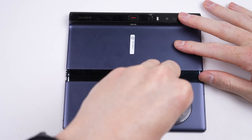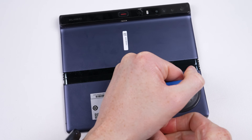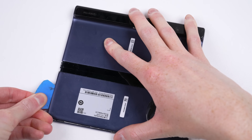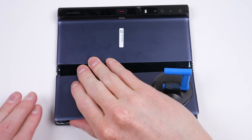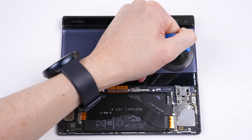Because it just seems impossibly thin. After the usual treatment on my heat plate, I could begin prying up the back, assuming it was the place to enter from. And I was right — the adhesive came loose with little effort. Lifting up the first plastic panel reveals a battery and a few other things, but still no motherboard. That's got to be on the other side.